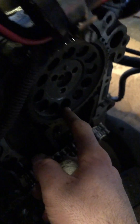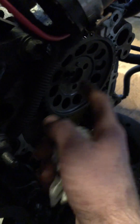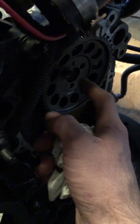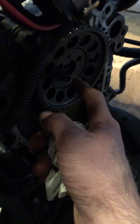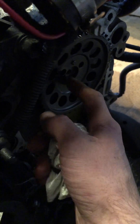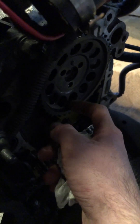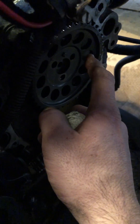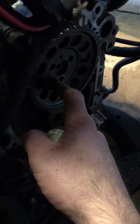The reason I'd say don't take that chance is because from here this oil goes down to the crankshaft, which feeds the mains. If there's any chance of oil starvation here you're going to either eat up a main bearing or a rod bearing — either way it's not gonna be good. So I'm glad I figured that one out real fast.